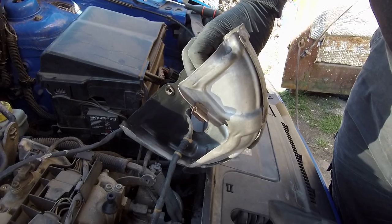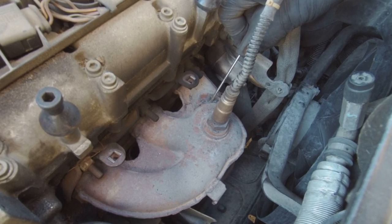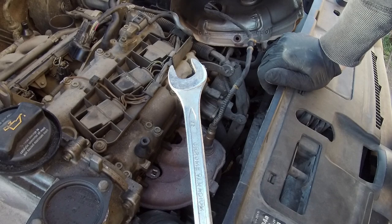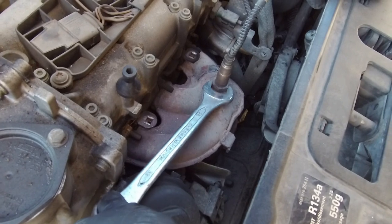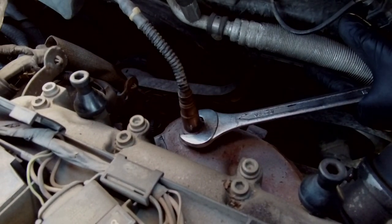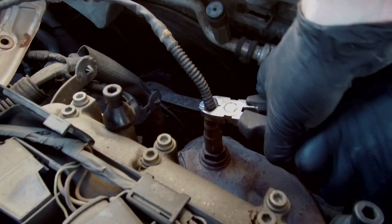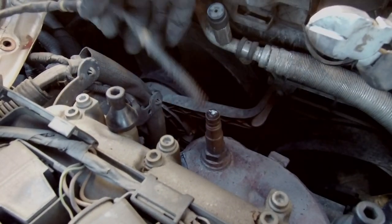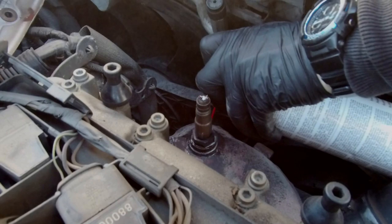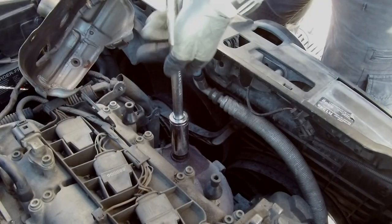And that's the clip. Oh, I want to show you something — the exhaust manifold is broken, there is a large crack here. We'll replace it in the very near future, but till then the car needs to run so we'll continue this job. Take the 22 mm spanner and try to break it loose. The leverage is too short and I don't want to hit anything around while struggling with the sensor, so I have to use a deep socket and breaker bar. The sensor wire will definitely get in the way so I have to cut it — the sensor is damaged anyway so it makes no difference. I'll use a bit of penetrating spray; it may help, but remember the exhaust manifold is cold. Don't spray it on a hot manifold because it can crack. And that was much easier.